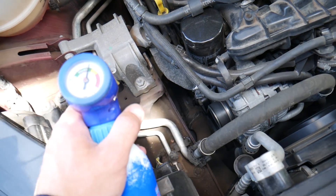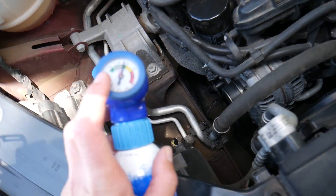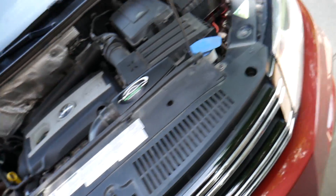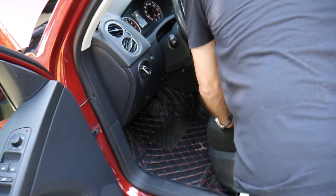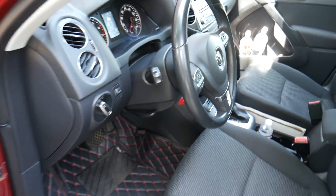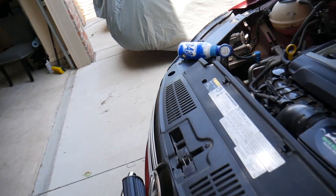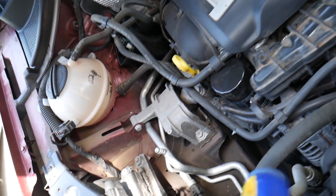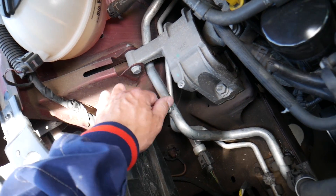You can see we're in the upper green area. This is because the outside temperature is really hot — if it's colder, you'll probably be in the middle of the green. When it's full and hot outside, it will be getting close to the yellow line but not all the way. Never disconnect the hose without turning the car off first, because the belt is there and you don't want to get caught in it. Turn the car off, safely disconnect, and place the cap back on to keep it clean.